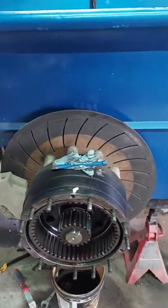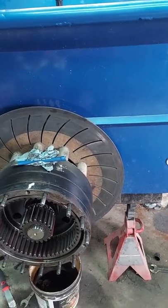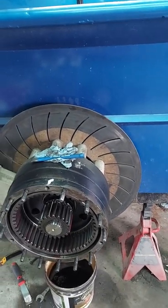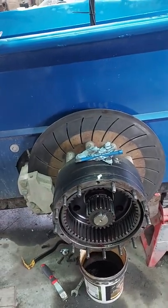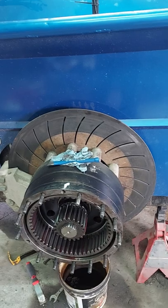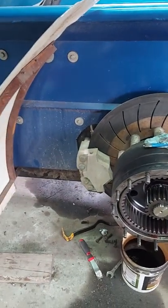On the two-wheel drive pulling trucks, most of the things they use are PR 75s. These here are actually 85s, so it makes it real difficult to mount the rims — you've got to have the rims just right with certain bolts to get everything tightened up. And then of course there are outboard brakes that are custom made.